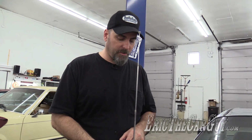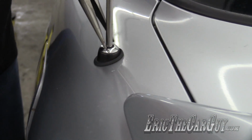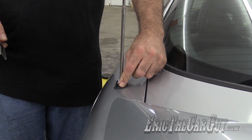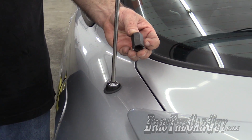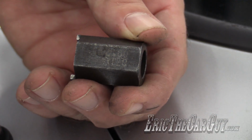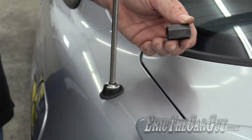This is the first place where you may run into trouble. Now, a lot of people may use a pair of needle nose pliers to try to get this antenna nut off. And that can work, but I'll be honest, you'll probably cheese it up pretty good. You can sometimes put a pair of channel locks around the outside of this and unscrew it, but there is a special tool available from Honda, and you can probably barely make out the part number there. I will link it down in the description to make it easier for you.